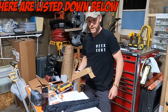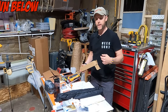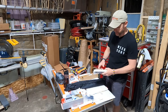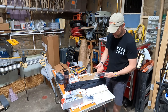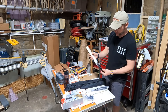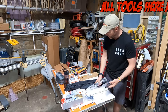I did some safety wiring incorrectly on both sides of the flapper mixer and had to cut them off and redo it — there's a lot of spinning of the pliers involved. So I picked up some aviation pliers where you pinch on the wire tie and pull the handle and it spins the wire tie down. I got two sizes since the two-size kit was cheaper than buying a single one.